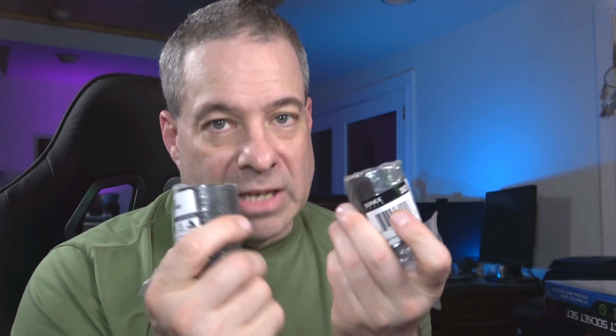When these heat up like they do, and the anvil of your impact heats up like it does, it's going to change the temper of the metal. When that does, they'll become more brittle and they will crack and break. So again, not a deficiency in the design or the materials, it's just they're being used beyond their limitations. Still covered under warranty. I'll still get you new ones when they break, but the bottom line is understand what the limitations are, and if you move to a larger drive size like a 3/4 or 1-inch impact, you will reduce that breakage significantly because there's simply more material there to dissipate the heat before it winds up changing the temper of the alloy. These are from Sunex. I normally keep these as the ones on the truck.